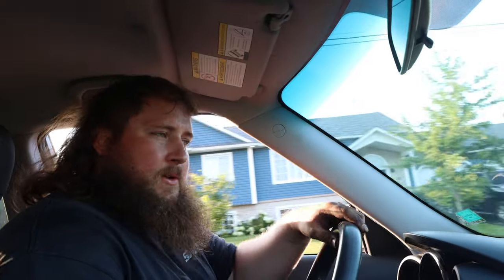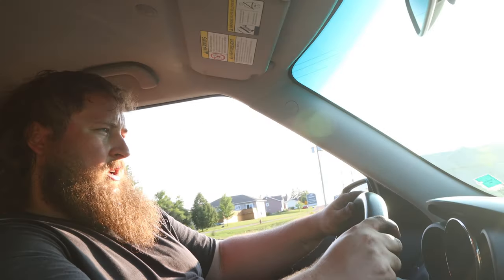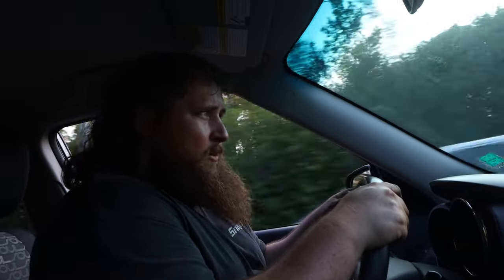I just torqued the wheels, I just checked all the brakes and pumped them all up — we're ready to go. Always make sure that you pump up your brakes after doing a brake job, because if you don't, something can happen when you start driving away. When you're road testing your vehicle after doing a brake job, there are a couple of things you want to check. One of those things is brake drag — you don't want brake drag, you feel it right away. This is a manual, so when you put it in neutral you can feel the drag. I don't feel a drag.